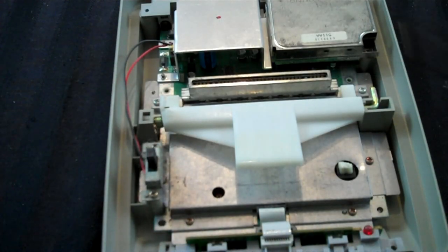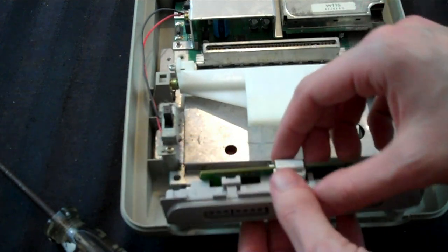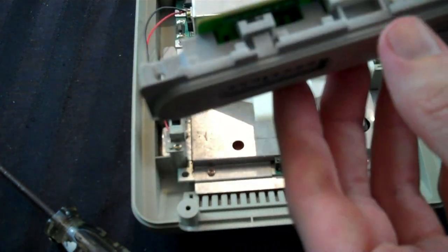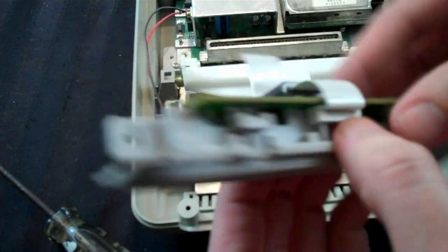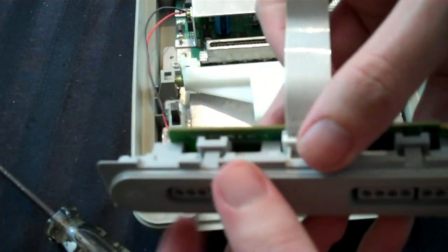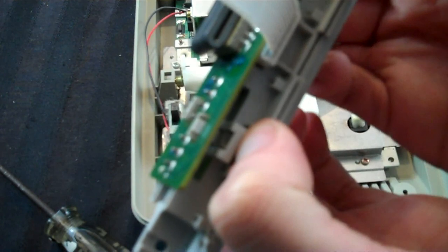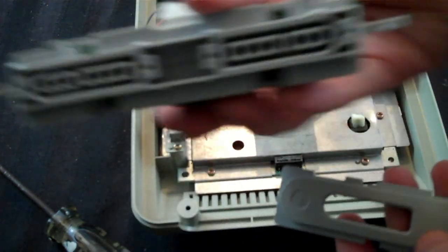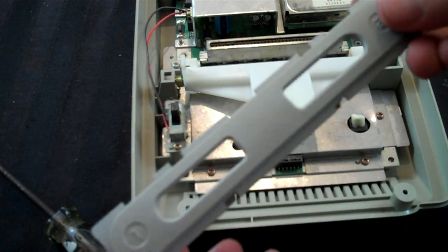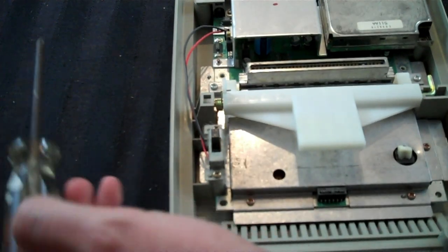What we're going to do is take it apart to get to the plastic. The easiest place to start is the controller ports. Just kind of take those and gently disconnect the ribbon there so you get the board pieces out. You can also clean up this plastic piece. What you do is thread this through here like this, and then there's a couple of plastic clips underneath on both sides — just push in on those a little bit and this top piece will just kind of come off. That's electrical, you don't want to try and clean that with water. But this, just like the other plastic pieces, you can take soap and water and clean it up, and try to get it as nice looking as possible.